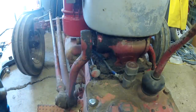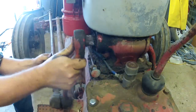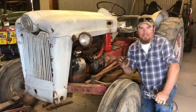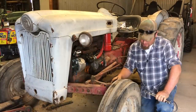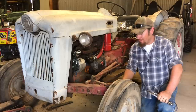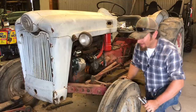And there she goes - yeah, that's a little rusty in there. Next, we're going to get this pitman arm off of the spindle here. It looks like one bolt with an 11/16th nut, and it looks like it's been on there since probably before I was alive, so we'll see how tight it is.